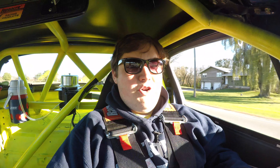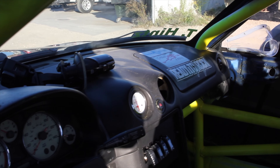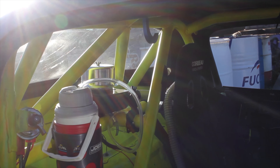Now let's talk about the interior. In front of me, the gauges are the stock Miata gauges — nothing really to see there. The dashboard is completely intact and still in the car, which is actually one of the rules with spec Miatas — you have to keep the stock factory dashboard in the car. It has a Driven steering wheel with an NRG hub. The radio has been replaced with switches controlling the electrical fans and other systems in the car, and the vents have been replaced by gauges. I'm in a bucket seat, there are harnesses, there is no longer a passenger seat, and there is a full cage.